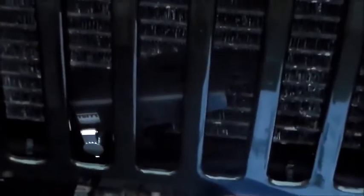I mean, it's a Jeep. It's going to go off-roading. It's going to get messed up and scratched and bent and dinged and everything else, so I don't really care about that. But it was quite a process getting it in there. So the thing to remember is, if you have air conditioning, remove the driver's side headlight, and it will slip right in. That air conditioning condenser is a real bugger, and that stupid dust latch on top, can't complain about that thing enough, gives it just that little bit more width that makes it a giant pain in the butt. Anyway, let's give a pause and I'll finish unbolting the factory hood latch.